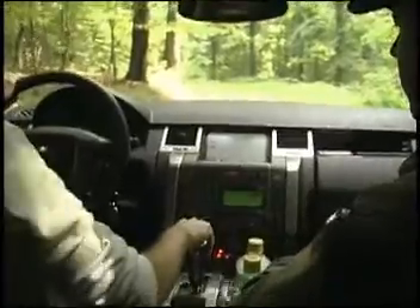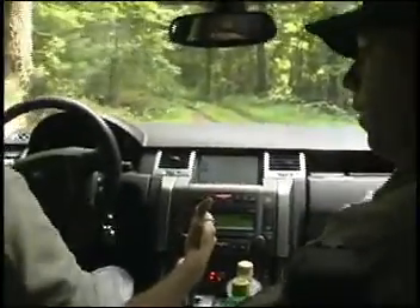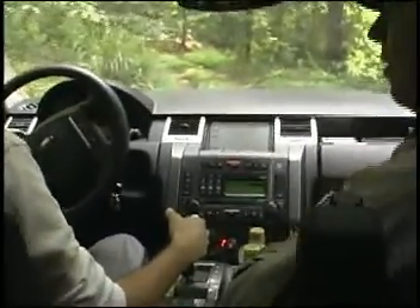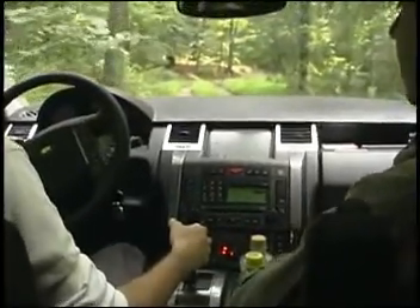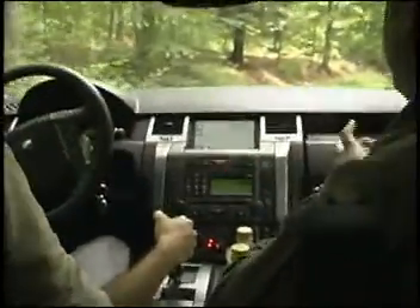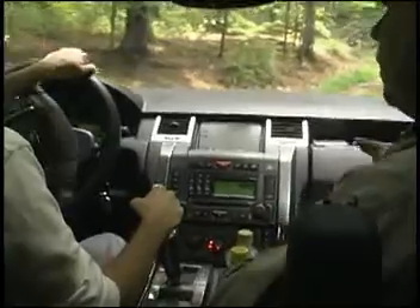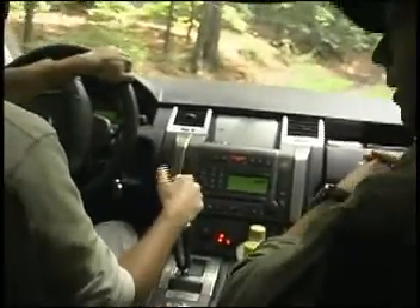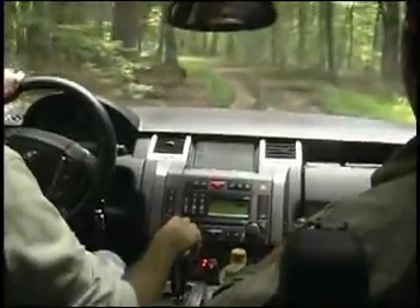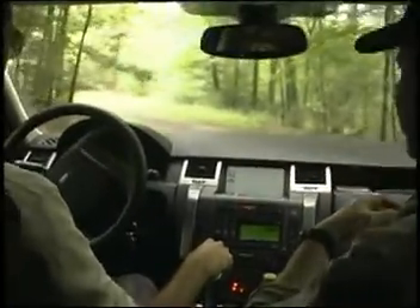Going back to drive — if you're in drive, can you just shift quickly into first? Here's the thing: in manual mode, sport mode does not exist in low range — it goes directly to manual mode. Notice it's gone to second gear. Whenever we go from automatic to manual mode, the transmission is not going to default to first gear — it's going to go into whatever gear it's currently in. Modern automatic transmissions are smart enough not to let themselves get into trouble. If the vehicle speed is too great for the gear you're trying to select, it simply won't downshift.